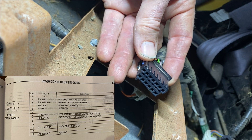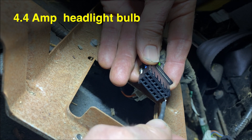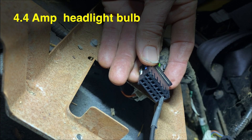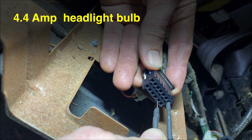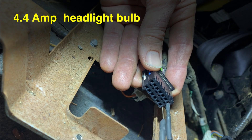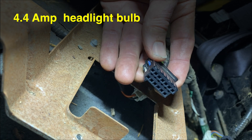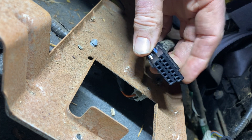Now let's see if these wires can actually carry current. I'm going to put this probe into the ground and this one into the full-time power — we get a light. Then on the switched power we get a light as well. So we've got power and ground; there's nothing wrong with the connector. I'm going to condemn the module.